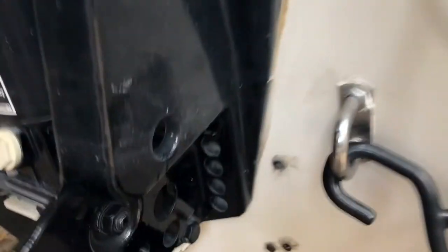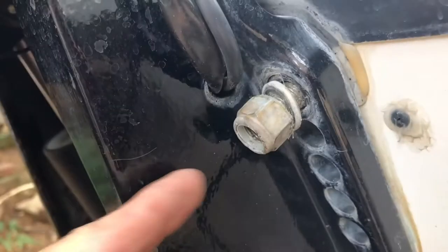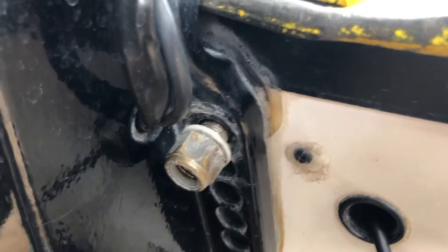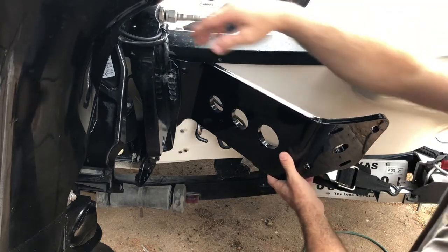You can see I've loosened these nuts — there's a little gap all the way down. On the other side I've got the bottom one off. This motor has come down a little and is putting pressure on the bolt, so if I try to knock it with a hammer I'll mess the threads up. I took a short nail bar and moved the motor to relieve the pressure off that bracket, and then backed the bolt out.